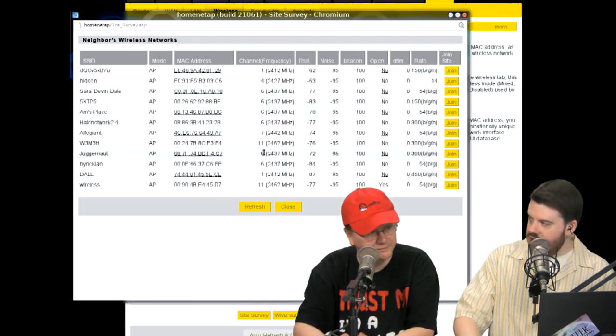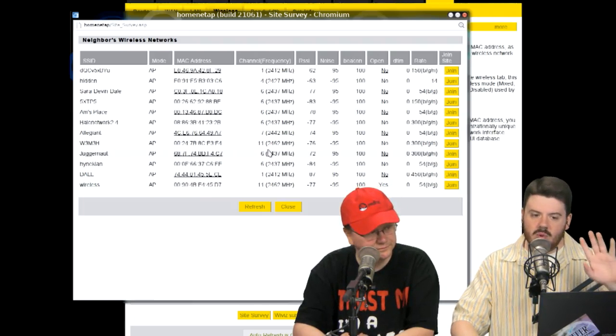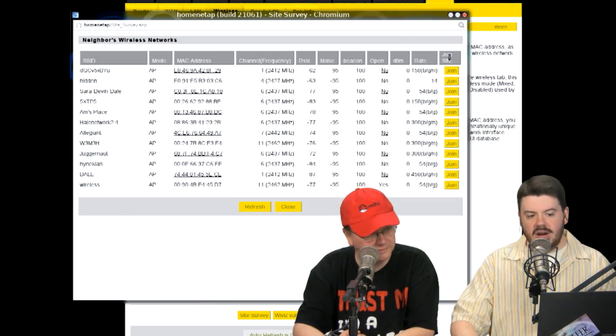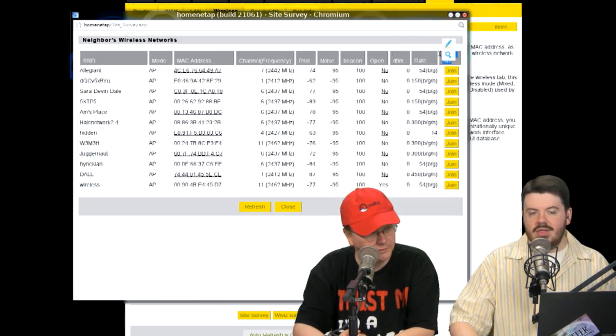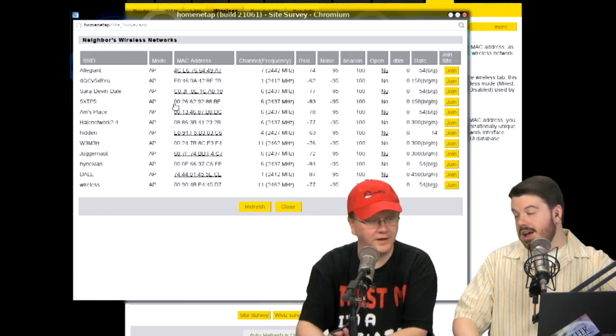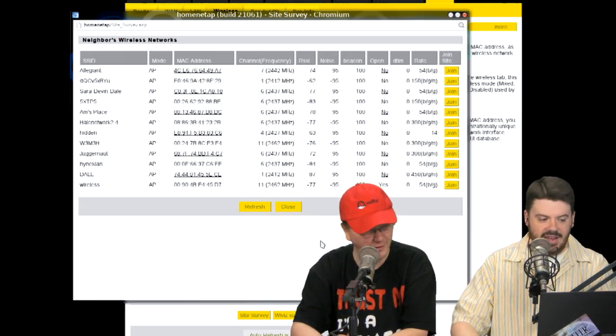Don't set my wireless to channel 6, because all of my neighbors are on channel 6. And if you're having one of these problems where your connection just keeps dropping in and out, even though you've got decent signal, this might be what's going on: wireless noise. And you see this button right here where it says join site. This is where that wireless extender comes in. If one of these was one of my other APs, you just click join. You have to define a couple other things, but yeah, simple.